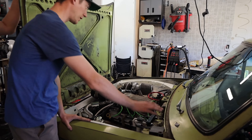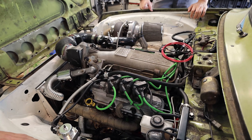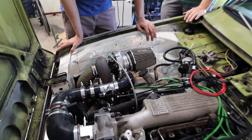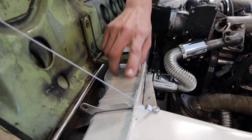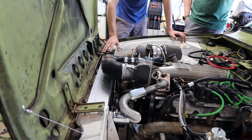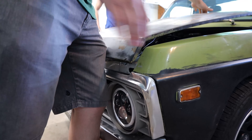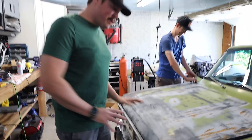We got the meth injection installed and also ended up installing 60-pound fuel injectors, so when the time comes we'll be ready for a little more power. We finished out all the exhaust wrap on this whole side, got mufflers on it now — before we just had a pipe sticking straight out. We also made a little cable and some spacers to hold the hood up so it clears the intake. Simple, kind of ugly, but it gets air flowing across the motor by design.